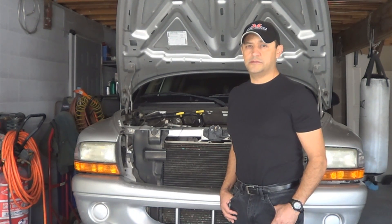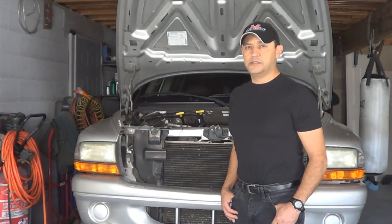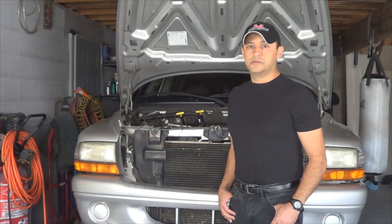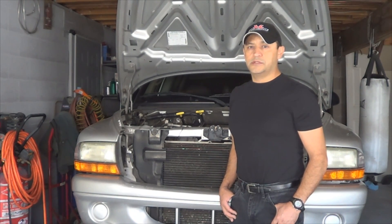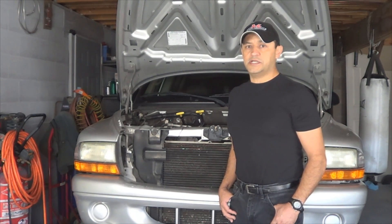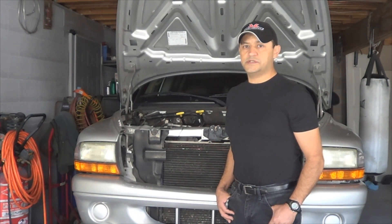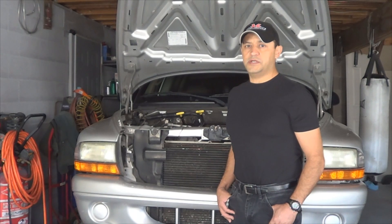Welcome to Ask Stephanie McCarroll's YouTube channel. This video is part 4 of the repair title, How to Replace the Cylinder Heads on a Dodge 4.7L engine. The vehicle we're working on is a 2002 Dodge Durango. The previous owner overheated the engine, and when we bought it, it was running rough and had a little bit of water in the oil. So it's very likely that the cylinder heads are slightly warped. We're in the process of removing them, we'll inspect them, have them repaired by the machine shop, and show you how to install them back with new gaskets in upcoming videos.